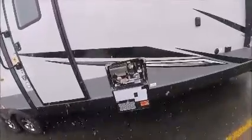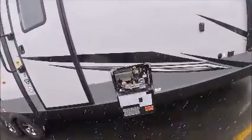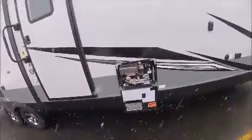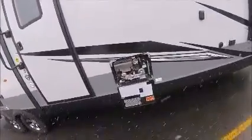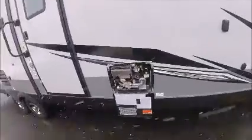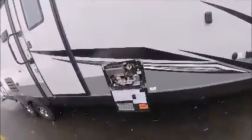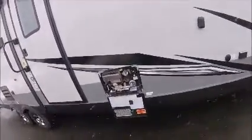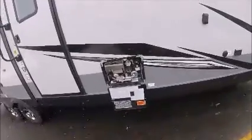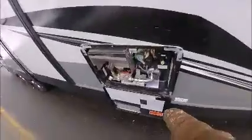As a side note, if you're going to pull the plug out of the water heater, you just want to ensure that there is no pressure in the system. So before you pull the plug out, you'll want to open up some taps inside. That way there's no pressure in the system. Up here is your pressure relief valve. It's a safety device made so if the tank becomes overpressured, instead of exploding, it relieves the pressure. It is normal for them to drip slightly when they're on their heat up cycle, so that's completely normal.